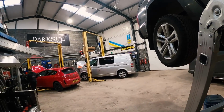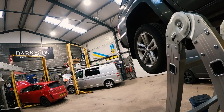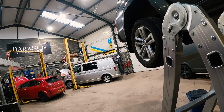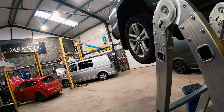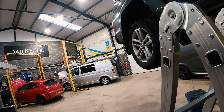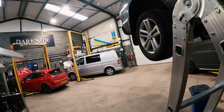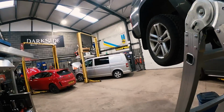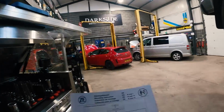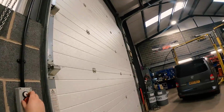But then to checking oil level, so that's filling it, checking oil level, start engine, check transmission temperature. If it's more than 50, I'm going to let it cool down. And if it's less than 30, you're going to warm it up, but it's definitely going to be more than 50, so you sort of got to decide how long you want this to take you. So I might have to mess about doing something else while I wait, but we'll see. So we don't gas the cells out.